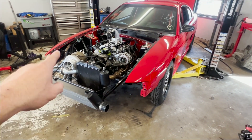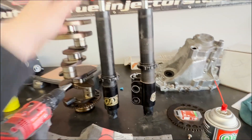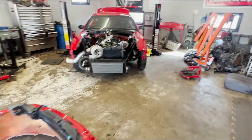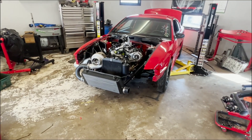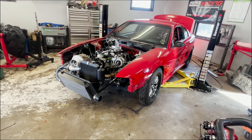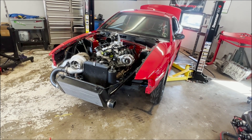I've got antifreeze in it and need to change some brake lines because I put different coilovers on the front — QA1 double adjustables. These old ones are vintage — retro as hell. You can see the adjusters are at different heights because they were blown out. I need to raise the ride height a little bit because where I want it to sit they're actually bottoming out inside the coilover, so that's not going to work safely even though I want it to sit low.